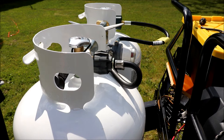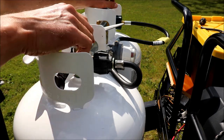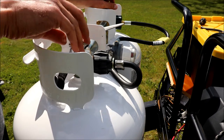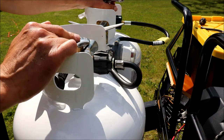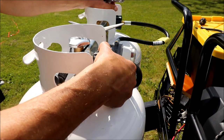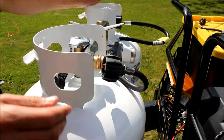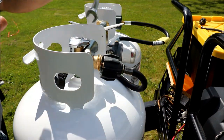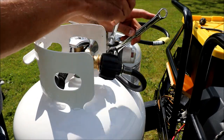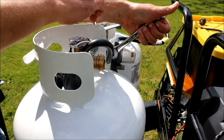I'm going to show you how to change the other one — it's always a good idea to change them in pairs. Use gloves anytime you're around propane. Make sure you get your tank closed, and use two wrenches whenever you loosen a connection like this — hold one fitting while you pull on the other.